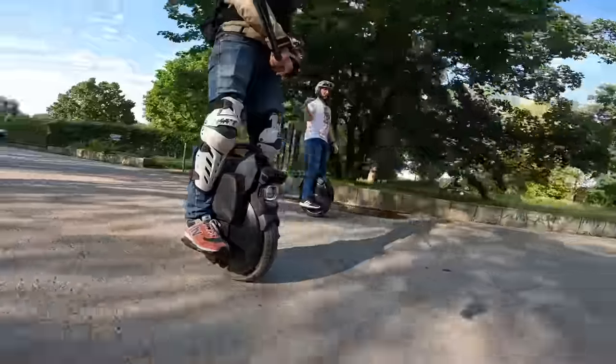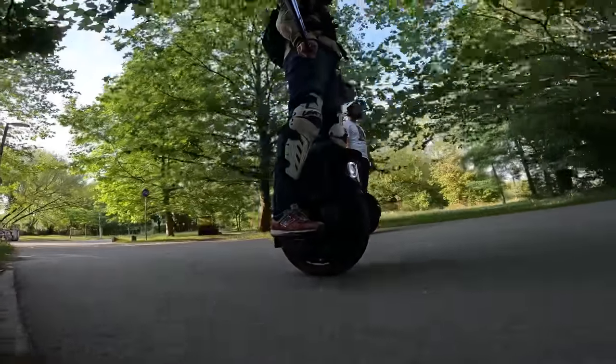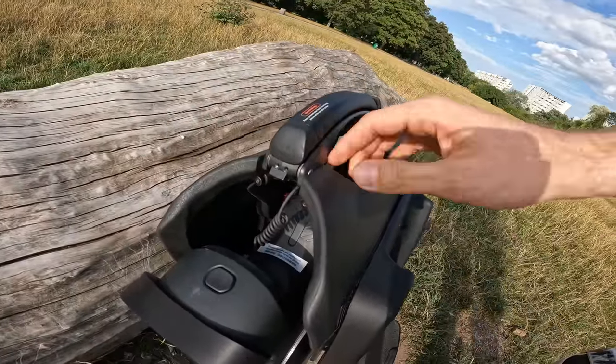Partially due to the high foot plates and the controller and motor setup, it's just not exciting — though you can make it exciting through your riding style, or if you prefer comfort, no problem. The shell is slightly easier to damage with more edges, and the early screws tended to fail — though that was later fixed. I also need to mention there were a couple of fires with the Inmotion V11. I've heard those were faulty units with possible water or other damage, including one case in Europe with an LGM50T battery pack. I'd only buy a V11 with a non-LGM50T pack — the newest batches use Samsung 50E cells.